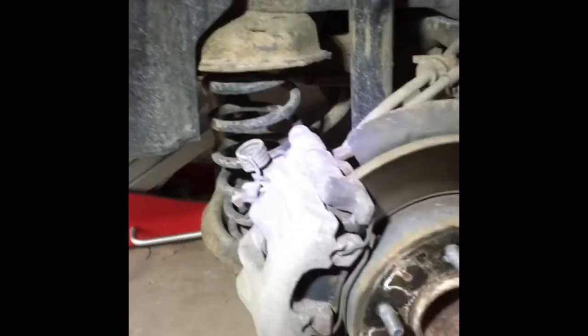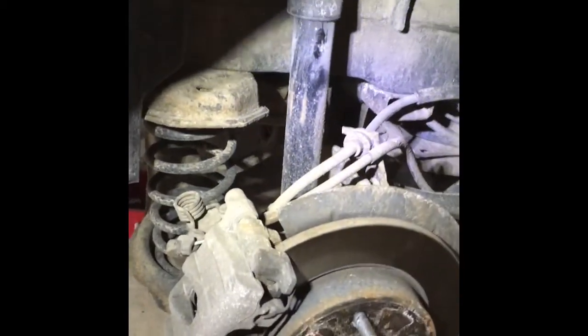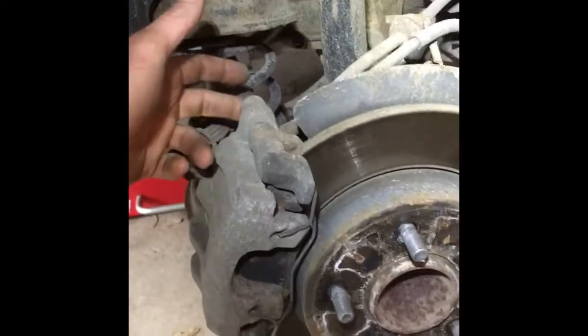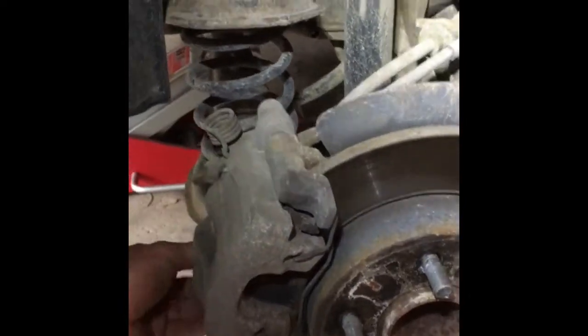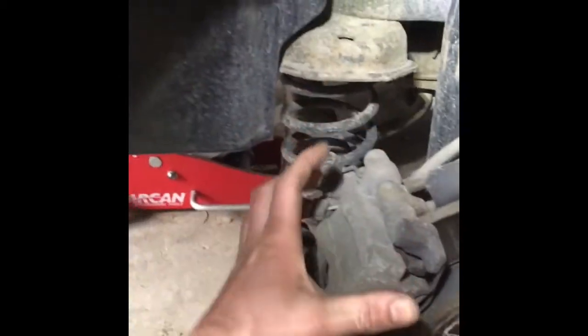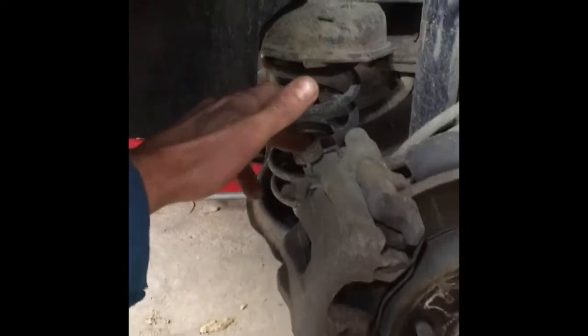So this one's gonna be a little different than the front one. Well, I'll show you. Right. What I'm thinking here is, you can see just the rear handbrake here, but you don't need to probably touch it at all. I'll see right away once I start it, but basically what you need to take off is just this pin, the safety pin again, and then these 7mm underneath is just 7mm Allen pattern bolt. So use your 7mm Allen key, take these off, and you should be able to swipe this guy all the way up here, and you won't be touching this guy at all.